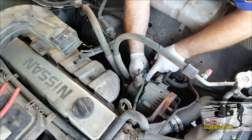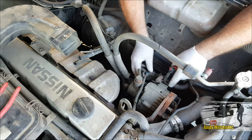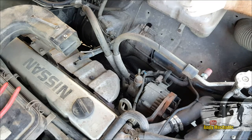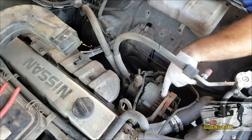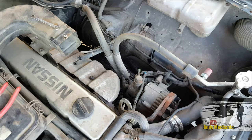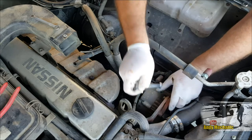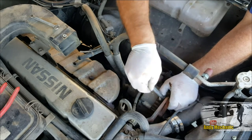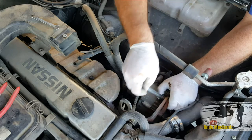There we go — look at the movement on that plug. That's the same plug as the replacement one. So everything's off apart from the main power output, which we call the B plus post. Now we can undo this bolt here — this bolt is the adjuster bolt for the tension on the belt. I think it's a 14. The belt could really do with replacing as well. The belt wasn't slipping, I checked that, but I'll grab a new one. So we'll take that adjuster bolt all the way out.